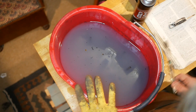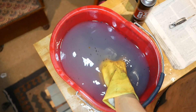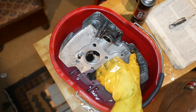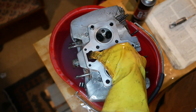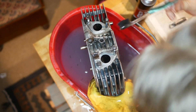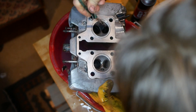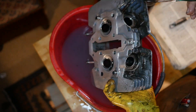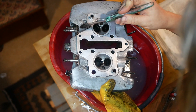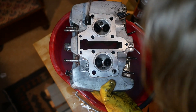Okay, so that's 10 minutes. During that time I read the instructions on the degreaser — there was nothing particularly useful but it does have a big skin irritation warning on it, so I'm wearing a glove this time. It has loosened up some of the dirt in the cosmetic areas, but it hasn't really made much difference in those holes and especially on the exhaust side, which is nasty. I'm not leaving this head in the degreaser overnight because I don't know what chemicals damage what metals over time.